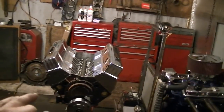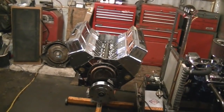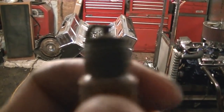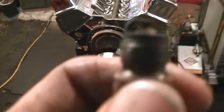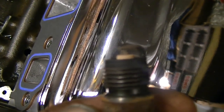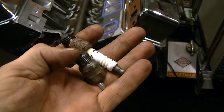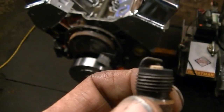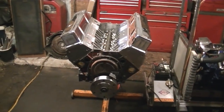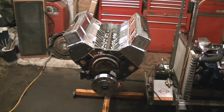Anyway, they probably rebuilt that, left these in there, got brand new spark plugs, tightened them all down in there, and they closed the gap on them — with all these brand new spark plugs putting them in. Because there was one of these in every hole and a plug in every hole with the gap closed down on it. So I'm pretty sure that's why that thing had cross-hatching in it and was never started, because there wasn't a single score in them cylinder walls.